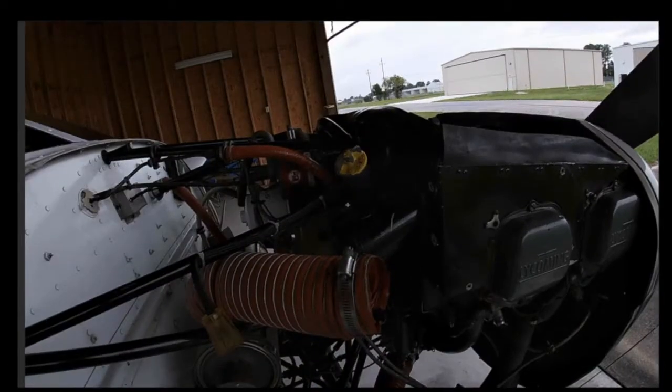Now, if I pull up this picture one more time, I will say that you are required to take off that oil stem, the oil dipstick stem. You do have to do that. You cannot get this baffling off unless you take that stem off. So you probably have to cut the safety wire down underneath and then just take a big wrench. I think it's a 3/4 inch wrench, and then just kind of pop it over. Hopefully it's not on so tightly that you have to really crank it, but mine wasn't, luckily. But you just pull it out of there. Make sure you have something to wipe off the dipstick, and then I stuck a rag in there just so that no moisture or any other foreign debris would get in there, and that's what I did on the intakes as well down here.